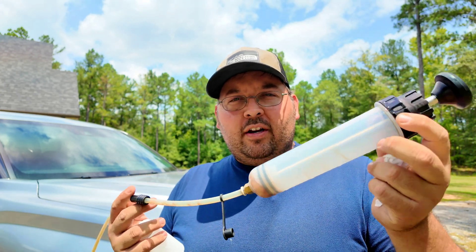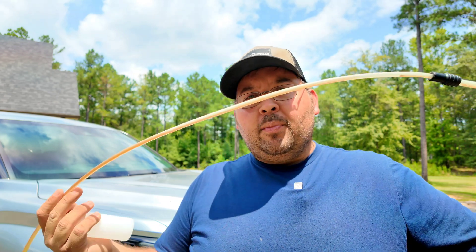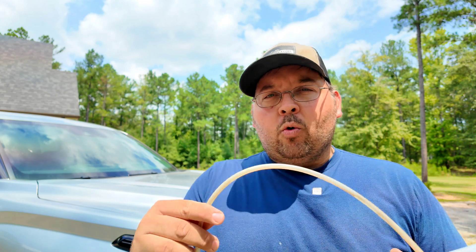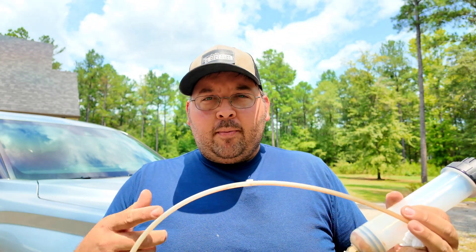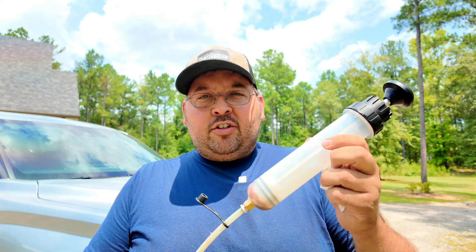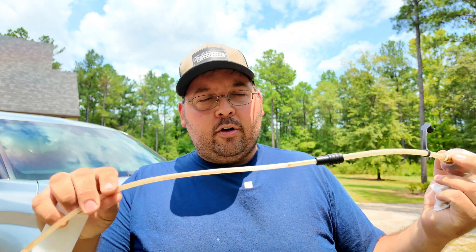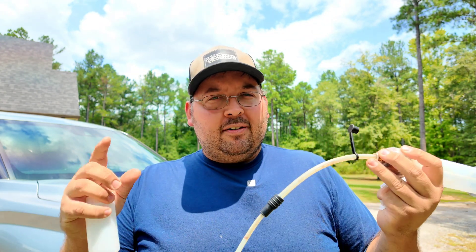There are two primary ways of getting your oil sample. You can either drain your oil and about halfway through grab a sample, or you can hit up your local Harbor Freight and pick up one of these — it's nothing more than a cheap vacuum pump. You will need to go buy some more tube. In this case this is nothing more than a quarter-inch ice maker line. You can pick it up at Home Depot or Lowe's — you can buy a whole 25-foot roll for like five or six bucks, way more than you need. Your typical kit from Harbor Freight will include a short tube with a connector that fits this quarter-inch tube, but it is entirely too short for most vehicles.